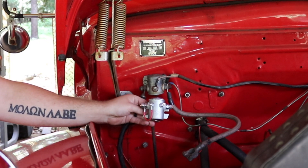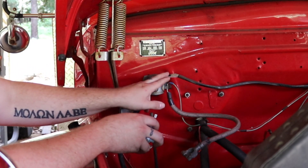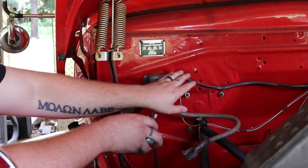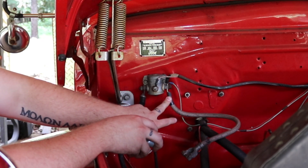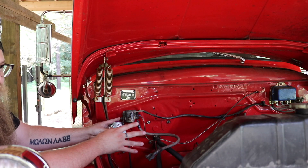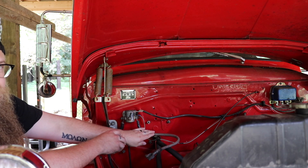So here's the visual difference. We're going to connect the battery cable. The cable on the side of the battery cable is going to be for the fuse box — it's very common for the fuse box to take power from the starter solenoid side. Take a mental note of how it was set up because we're going to replace both this wire and the starter wire in the process.